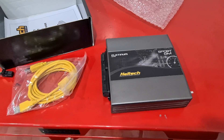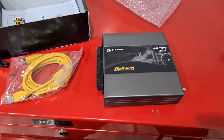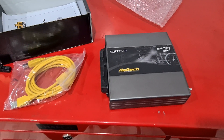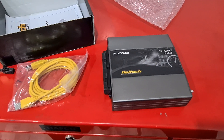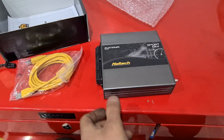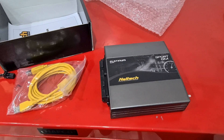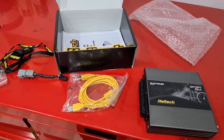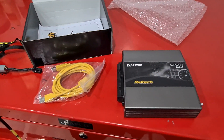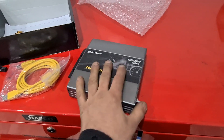It will work with the V6s as well as the V8. It's a multi-point fuel injection system but it's limited by the actual wiring loom. Haltech have made a system to plug straight in — this is a true direct plug-in. You plug this sucker in, load the base map in, and away you go. If you've got a Holden 5 litre or a V6 with a camshaft in it, this is pretty much the best plug-in ECU you can get.